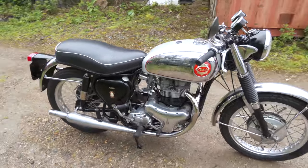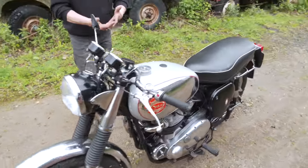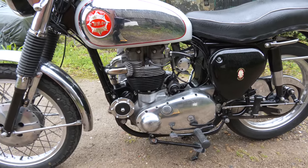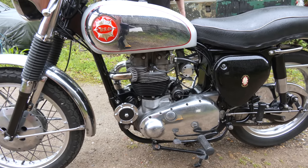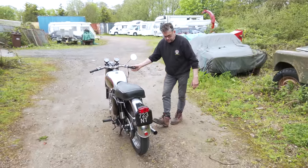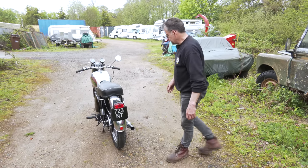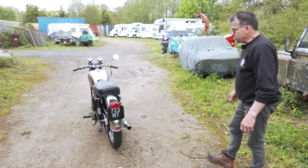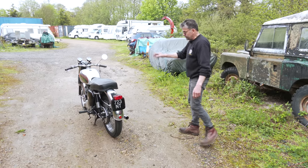Let me do a walk-around. What are you listening out for on these? Basically we're listening to hear any noises in the engine — any rumbles, which this hasn't got. Sometimes with engines you can hear bottom-end rattle noise, or top-end tappety tappets. All very nice and quiet, picked up nicely. The engine's very sweet. We're looking to see if it's smoking, which it isn't. It's got a nice, regular tickover. This has got the Triumph clutch in it — four-spring clutch. It runs on a six-volt lighting system, all as it should be. At the moment we're in touring trim, that's all.